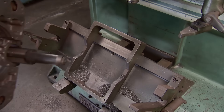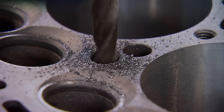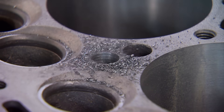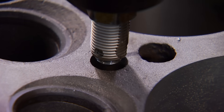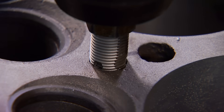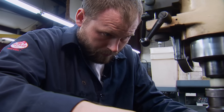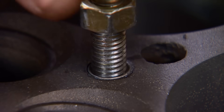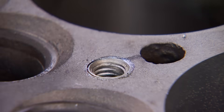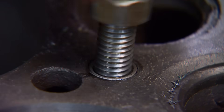Now it's time to get to those cracks. We're going to start by picking the thread insert and drill bit to drill out the original hole where the crack starts. Then we lube the threads on an insert that's installed on a bolt with a nut run up to the top. With the head cut off the bolt, I'll use the drill fixture to keep me straight and simply tighten the nut to insert the new threads, stopping the crack and giving the new studs a stronger clamping area. That's all there is to it — then I just repeat the process four more times.